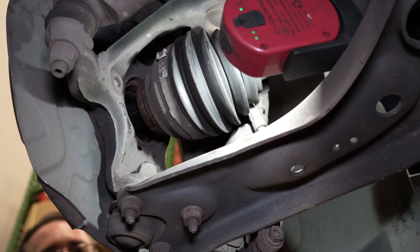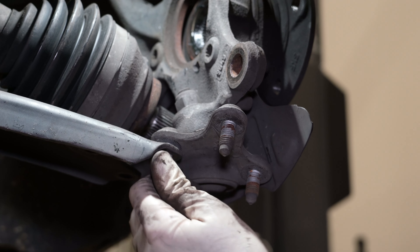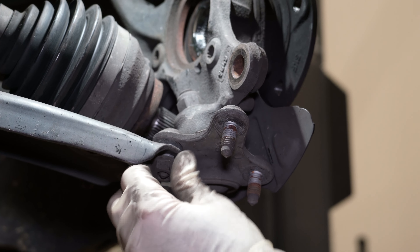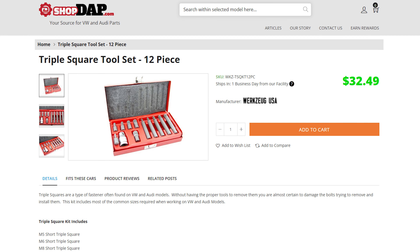That means it's loose. Ball joints — three nuts. Got some tension on this ball joint. Here I've reinserted one of the studs of the ball joint into the control arm and then threaded a nut on. I'm doing this so that it doesn't move around while we're trying to break the wheel bearing bolts loose. There are three of them and they're 10 millimeter triple squares. If you don't have one, you will need one — we'll link to a triple square set in the description.